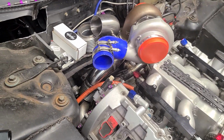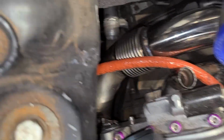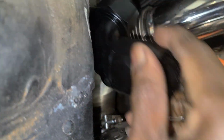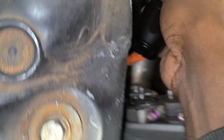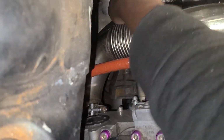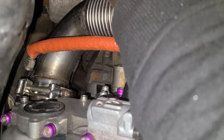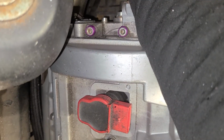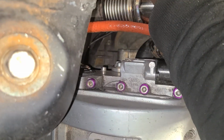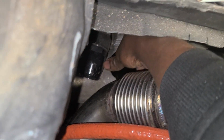Okay, so now back over here. This fitting goes on that extra dash 20 pipe that's down there. Move that over there. And so that goes there. I didn't cut this dash 20 line yet because the extra piece from it will be used to plumb this other 90 degree. So I purposely bought it extra long so I'll have enough play to be able to cut it. Try to get it down there. There we go.